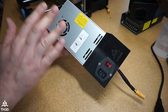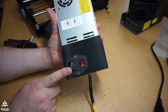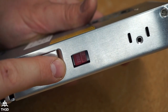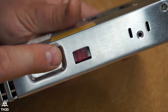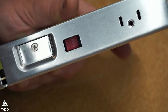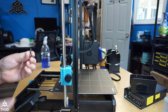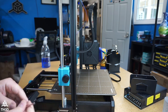Now we have the new power supply assembled — the new Meanwell is in here with our custom cover, the receptacle is in the new housing, and the DC power is coming out the bottom. Make sure the switch is in the off position. You also need to set the voltage switch to the correct voltage for your country — these all come set to 230 volts. I'm in the US, so I'm setting it to the 115-volt setting. Now we can put this back on the printer: plug the cable back in, put one screw through the holes, then put the other one in the bottom and screw the power supply on.